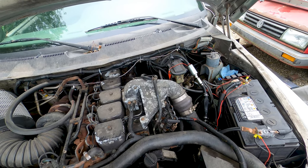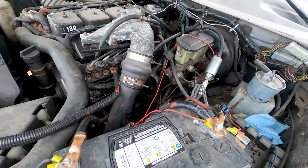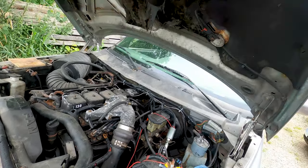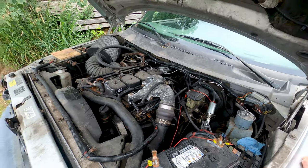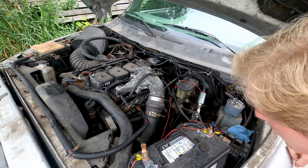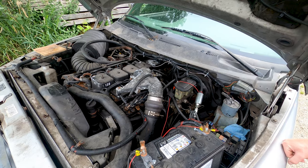So, trying to get to, well, there is a lift pump on there. Trying to get to the lift pumps on these things is just horrible. It's supposed to be a thumb primer to prime fuel from the tank to the lift pump at least. I find they don't usually work, even on the brand new pump I put on the other truck. So there is a lift pump on here, but if I remember correctly from when I was trying to get it going way back, it doesn't work. It wasn't pumping anything. Now, whether that's because it's clogged full of vegetable oil, who knows?